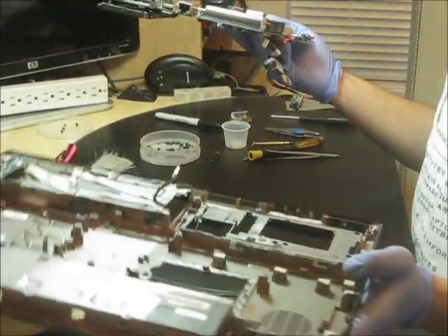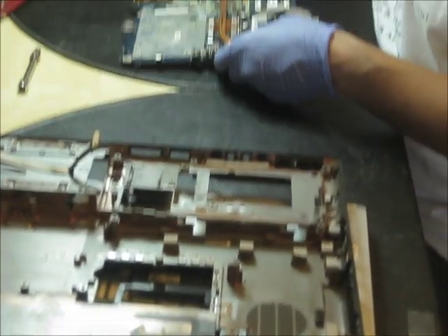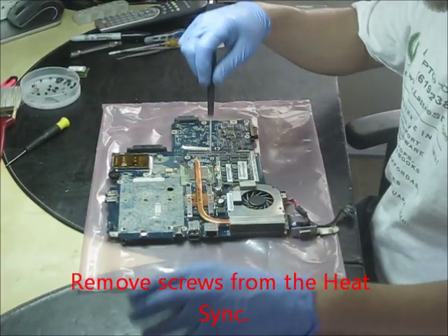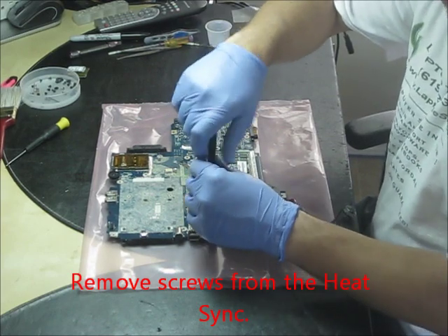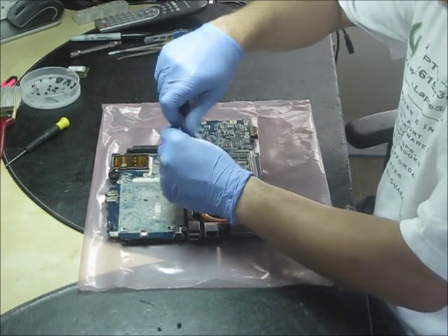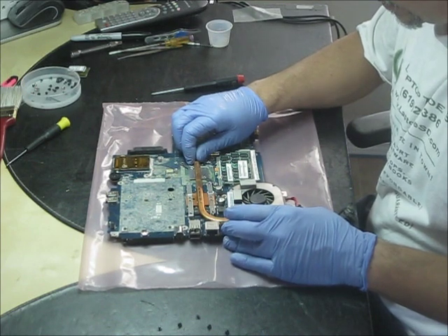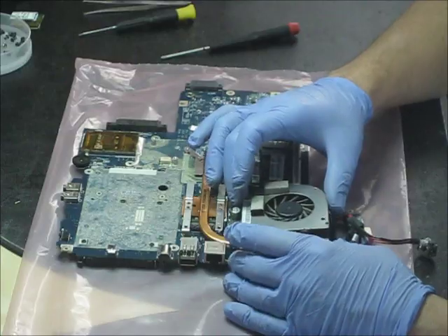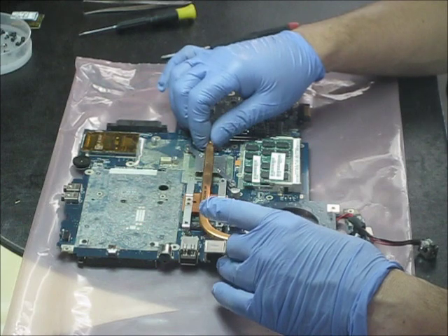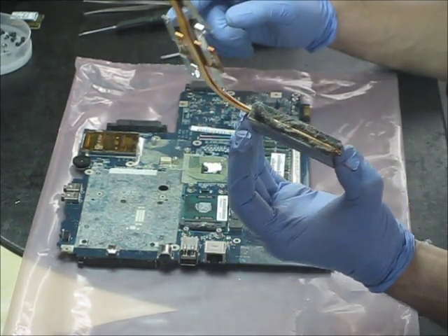This is the base cover — they are in a safe place. Now you have your motherboard. Now you have to remove the screws for the heat sink and clean the lint from the fan. Gently move it through the sides, and now you can remove the fan and the heat sink. All the lint and dust you have to remove it.